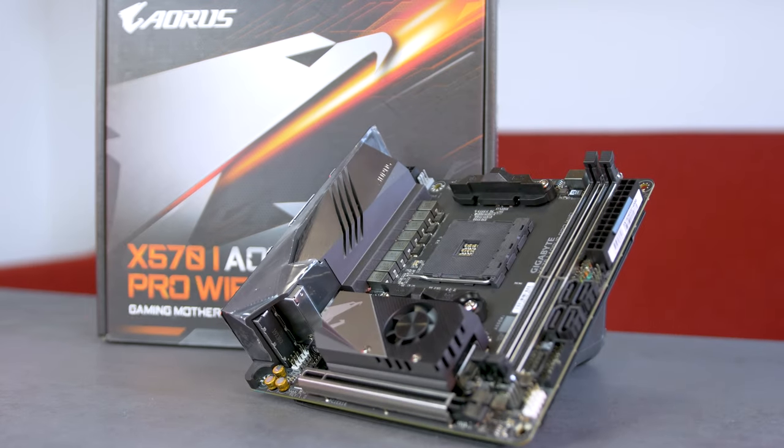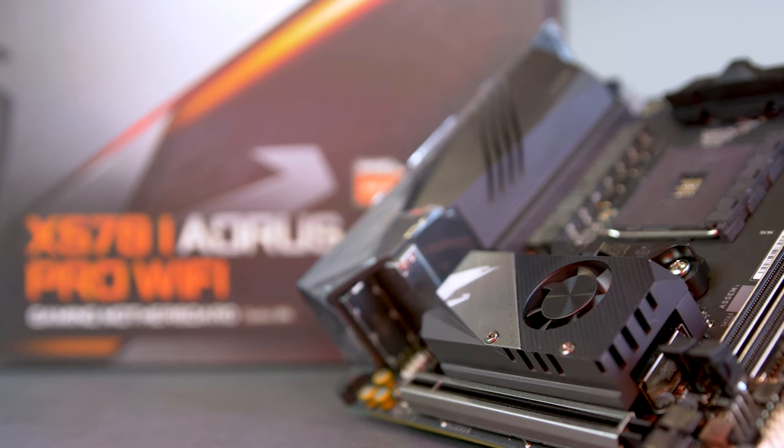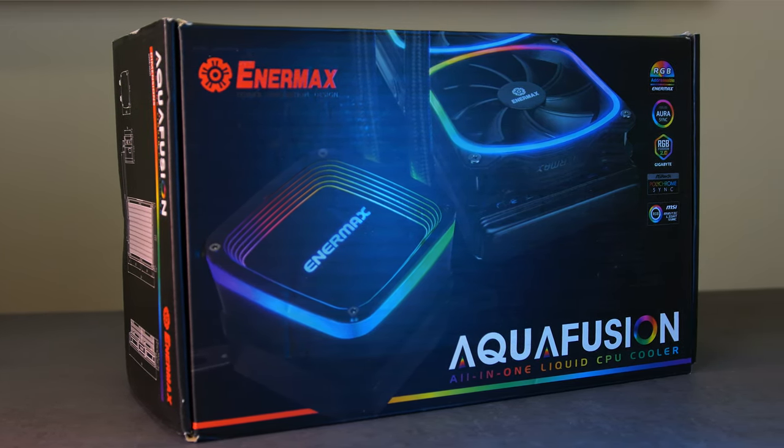In order to create your own PC case, you first need to decide on what hardware should actually fit into the case so you can design it accordingly. As our aim is to go for a small form factor PC, we decided to go for a mini ITX motherboard. For the graphics card, we just wanted to have enough space so you can even upgrade later on. For cooling the CPU, we opted to go with an AIO and a 240mm radiator. For the power supply, we decided to go with the typical form factor.